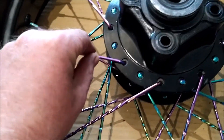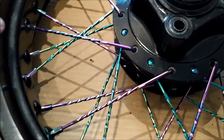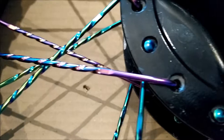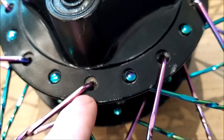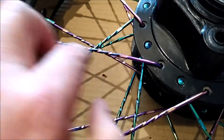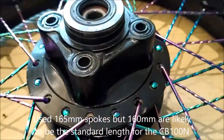The top spokes are very easy to put in because they just drop straight down. What you're looking for is the natural angle of the spoke. When I actually redid it, I decided to just go with the flow and use the marks — there were marks on here previously that were into the alloy, and I followed that and got the applicable angle across, and then it's fine. I still do have excess bits of spoke sticking out, which will be trimmed off once I get the thing properly trued.